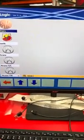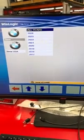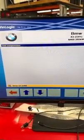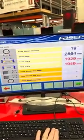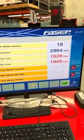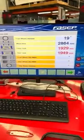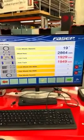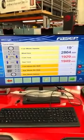You'll then select the vehicle as per normal, so either a saved customer car or picking the car for the first time. And when you get to the spot to do the input track, it's already pre-filled in those measurements for you now. The difference is by using an ATM, we are now scanning the outside profile of the rim. So instead of scanning on the inside of the track measuring gauge, we are now taking the exact measurement of where the sensors will be sitting on the wheels.